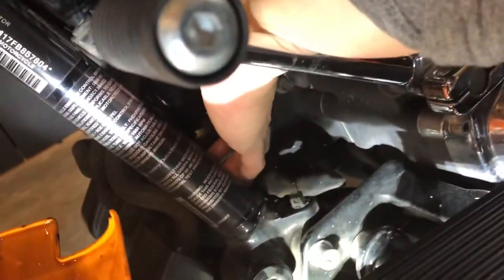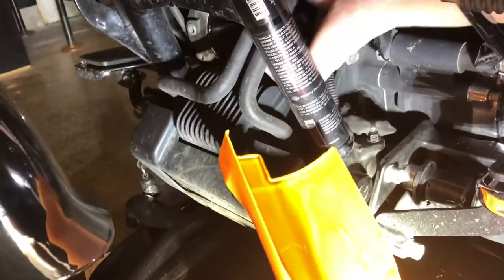Goes to a slow drip. We pull out the little funnel holder thing so that it's not in the way anymore and we don't get our filter full of oil. Then we put our new fresh filter on there. Got it, yep. And you just hand tighten it, because you don't want to over tighten it. Just get it as tight as you can with just your hand.